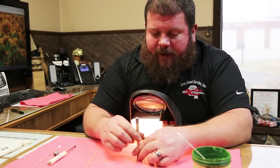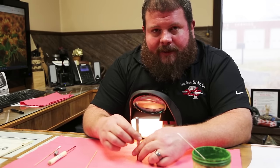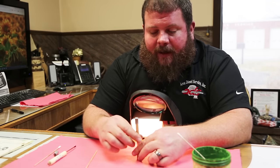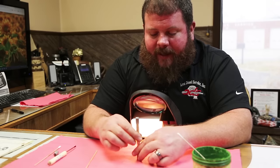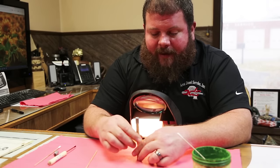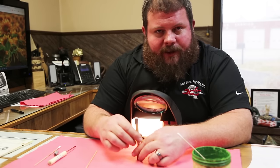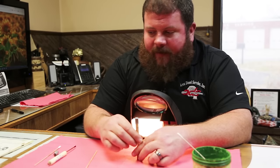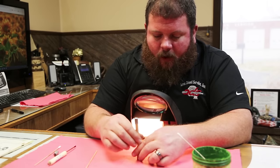The tolerance for a freshly remanufactured or brand new injector is tight, and that is the test plan. So when a customer sends in a set of injectors and you run them on the equipment against the test plan for a freshly rebuilt injector, a lot of times it'll fail, but maybe it failed by 1%. So is that truly a failure, or is that a service level accepted? It's got 50,000 miles on it. It's not going to be within the tight tolerances. So there's a given level of gray area open to interpretation. You're not going to pick up 1% deviation in maximum fuel delivery, but if it's 50%, obviously that's failed. A lot of gray area there. We've actually written some different test plans for injectors from the field, open to interpretation.